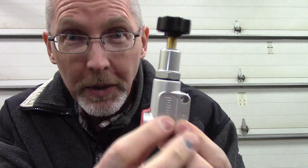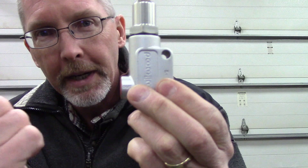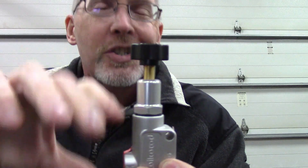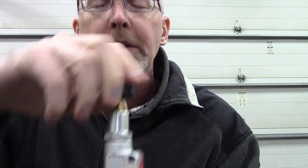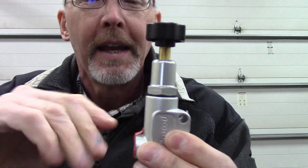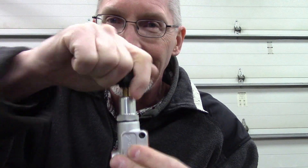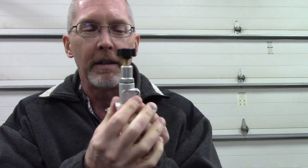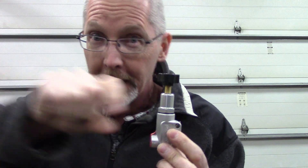I'm not going to disassemble and show what's going on inside. But this is the inlet side — you put a brake line in here, and the brake line there goes to your brakes. You can adjust this and it changes the pressure you can get. You want more back pressure? Looks like you turn this in to tighten up a spring, and you can have more and more back pressure getting to the back wheels before it shuts off. Or, if you need less, you can turn it the other way. Put it in the vehicle, hit the brakes really hard — if the back brakes lock, that's death on a corner, so you dial this in to make it not lock. You want your front brakes locking, not your back brakes.